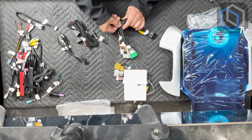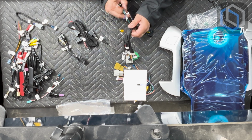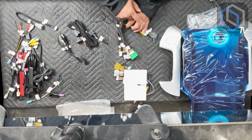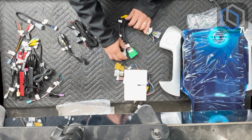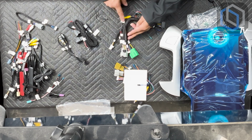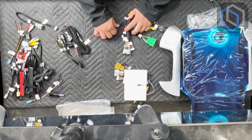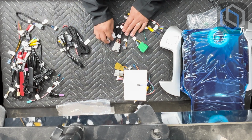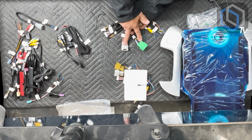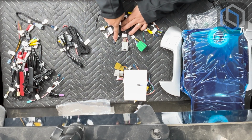You're also going to be doing the same thing with the other loose wires. Turn on, backup camera trigger. You're not going to use those. Tape them up so that the gel tips don't fall off. And so now, besides camera, OnStar audio, you have these plugs right over here. So let me show you what's going on here. So main power speaker plugs would be these 2 right here. And then we have that multi-channel camera interface plug that you're not going to use.